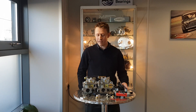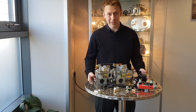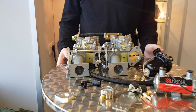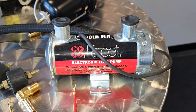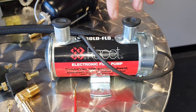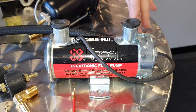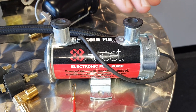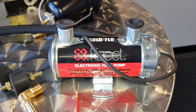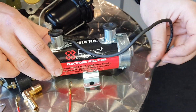So that's the SU kit. If you're running a Weber — we've got some twin split Webers here — if you run a single 45 DCOE Weber, then we do this kit right here. We go to a cylindrical pump, same Facet make but it flows a little bit more fuel. The solid state pump is 121 litres an hour at 4.5 to 7 psi, whereas this one is 151 litres an hour at 6 to 8 psi.